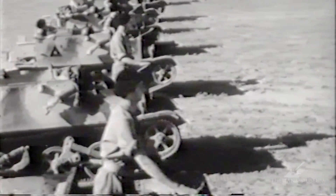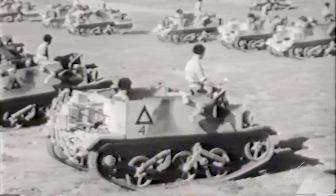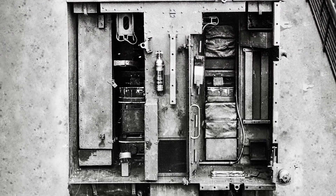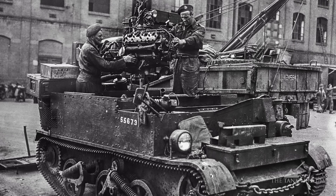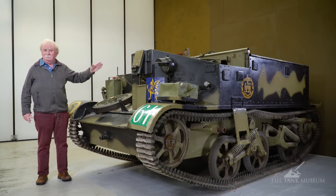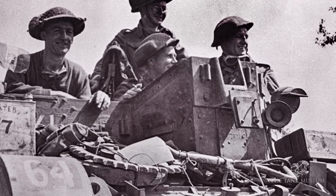It's a tracked vehicle with quite an unusual drive system. The back, which is where the load is carried, is really divided into three parts, and the centre part is taken up by a Ford V8 engine, which rather spoils the accommodation area there. It had a Ford V8 engine driving through a four-speed gearbox into a conventional truck-type back axle, just like an ordinary lorry, and was quite a delightful thing to drive.